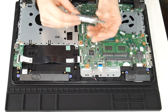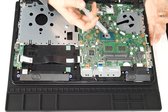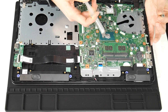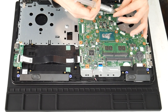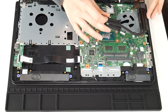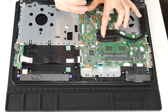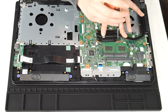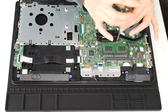The next thing I'm going to do is use some thermal paste on the CPU. I forgot to clean off the CPU before doing this, but I do recommend that. As you can see, it's dried out and there isn't much on there, so I go ahead and put some new thermal paste. I've put a link down below with some good quality thermal paste, because not all thermal paste is created equal — you've got to get the good quality stuff. Then put your heat sink back on. There are four screws and it's kind of like putting a tire on — you go one screw and then across to the other screw at an angle so that you don't get one side tighter than the other.